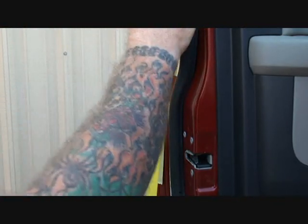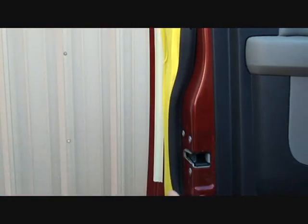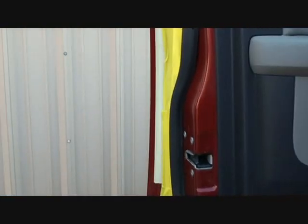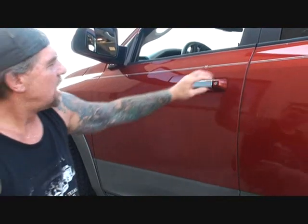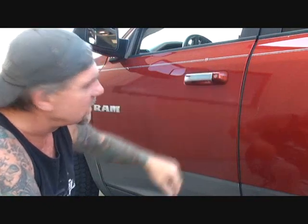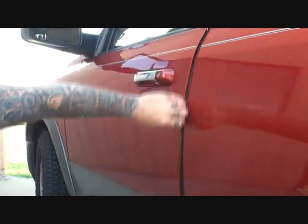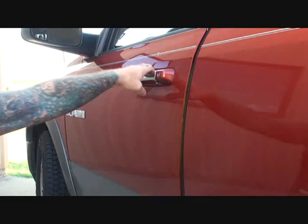I'd expose the lip that rolls around, then come back with my inch and a half tape and build that tape up so overspray won't go in. Or I'd use a tape machine and put a piece of paper all the way around the door for a nice clean edge. Another good option is to leave the door jammed open on the first click so paint and clear can actually get inside that edge on each section.